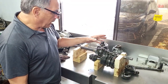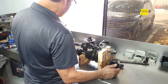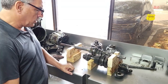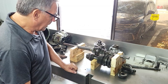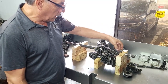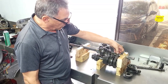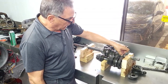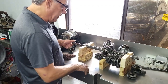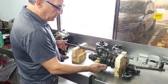So what's really going on: these are the four speeds. Fifth speed is here, in the back of the case. Looking at these gears — even non-engineers know a little bit about physics. If you turn a small gear connected to a larger gear, the larger gear is going to turn very slowly. I don't know the gear ratios exactly — you can look them up in your service manual. But you can see how many revolutions this is making compared to the big gear.